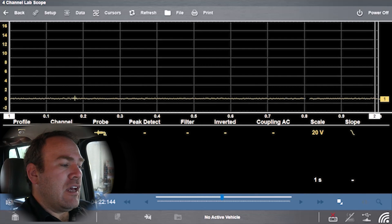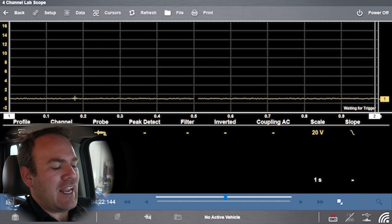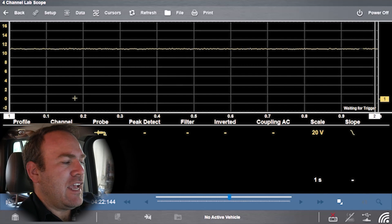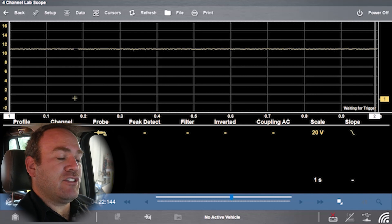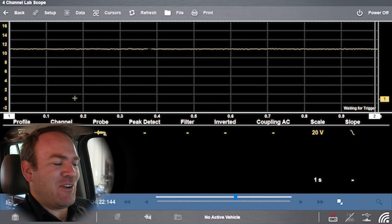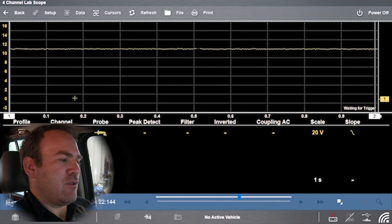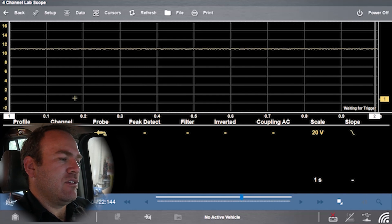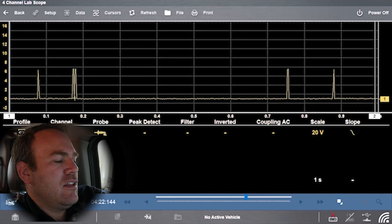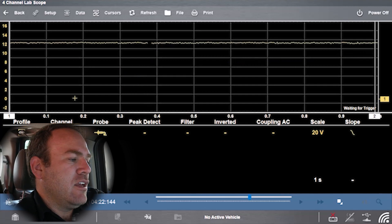I have the Zeus set up on channel 1 with a scale of 20 volts, and I put quite a bit of time on the screen because we're not really looking at the integrity of the data packets right now — we just want to see if we have a signal. I'm going to turn the key on. We had a little bit of a signal and then it went to 10 or 11 volts. I turned the key back off and we're still stuck at that higher voltage. Right now we're sitting at 11 volts — it just dropped back down, we have communication again. Let me go ahead and try to start it. Go to start it and we are right back up at battery voltage on our communication line.